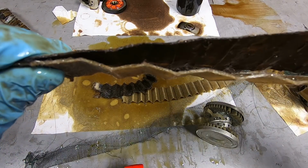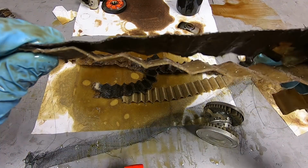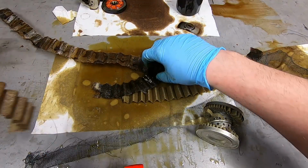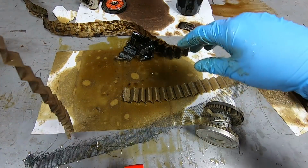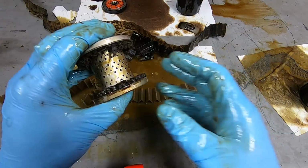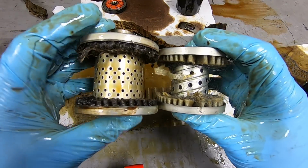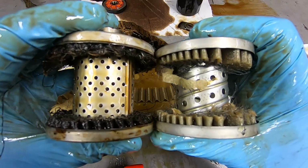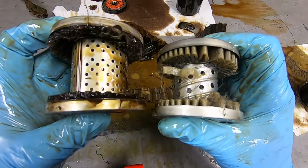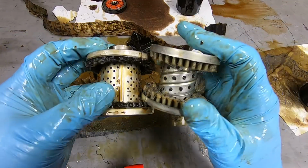So they're two completely different filter substances. But that's interesting, where the Harley Davidson one is a two-part type of construction. And let's look at their metal filter guts. So on the right we have the Wix. On the left we have the Harley Davidson one. So lots of small little holes, where the Wix has quite a few big holes on it.